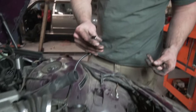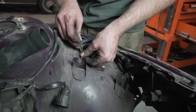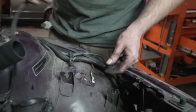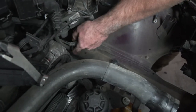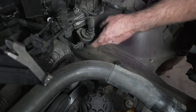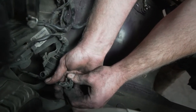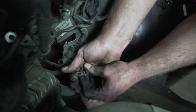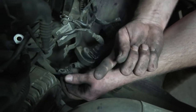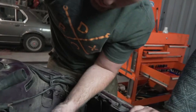That line forks — one of them right here is a ground for your secondary air pump. This is one of those connectors. Once you get that off, you've already undone this — this is from your mass air flow sensor. Then you want to take this rubber grommet off your secondary air pump, because we are not going to be pulling the secondary air pump with the motor. What you're going to want to do is push inwards on this clip — it starts in the locked position, push it forward to elongate the plug, and then you pull outward from the solenoid and it should come right off. This wiring loom is going to come with the motor, so the rest of this stuff can stay connected.